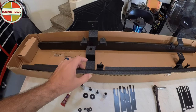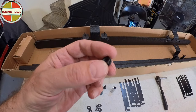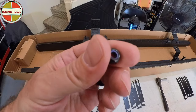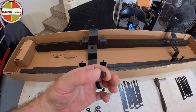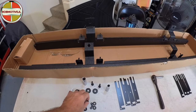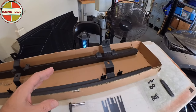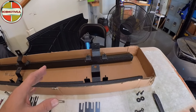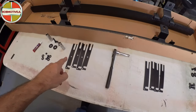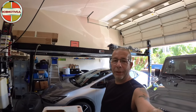The hardware that's just going to sandwich onto that rail underneath there comes as nylon threaded lock nuts, so we don't need anything to lock those on. Although if you wanted to go the extra mile, you could put some Loctite on — I don't think I'm going to, but we shall see. First thing is to go ahead, get underneath or beside the Jeep and make sure they fit how I want them to, and that everything lines up, and discover whether or not I'll need to use any of these spacers. So I'm going to put you on the hat cam and we're going to get started.